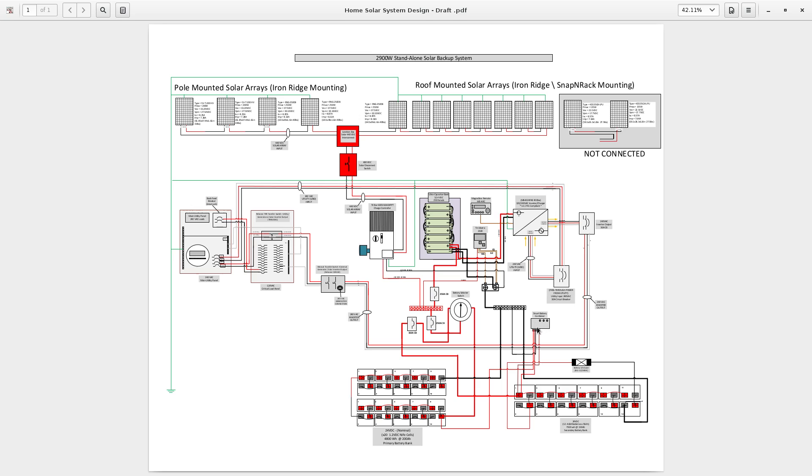The smart combiner will leach up to 25 amps from the main battery bank and supply charging power to the secondary battery bank. Each connection goes to the positive terminals on both battery banks, the negative connects to the negative bus bar, and there is a battery voltage sensing wire.